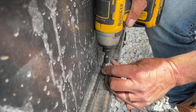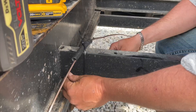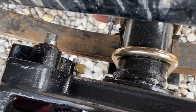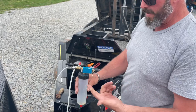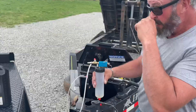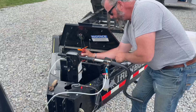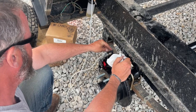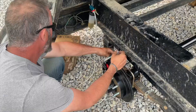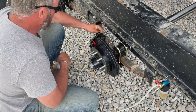Don't kink it — there we go. Just a cheap little power bleeder that we use, but we actually use it to catch fluid too. We're using the pump to force it out. I've got Elliot in the cab, and as I tell him, he turns on the brake controller to start the pump up. We're gonna get these things bled. Really heard that pump prime up — geez, that thing pushes the fluid.